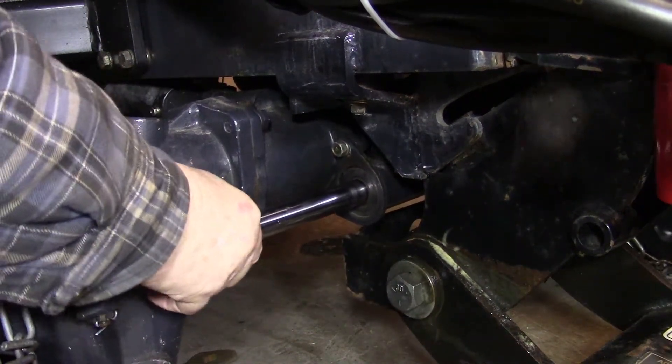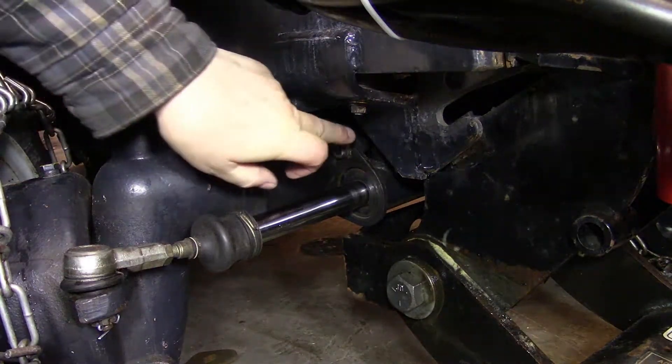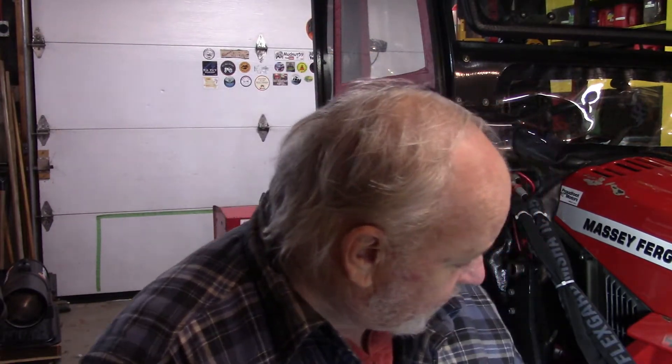You can see that moves around a fair amount in there, so my plan is to change those flanges. What I like to do before I start any kind of a job is check to see if I'm capable of doing it. I can do a lot of things, but some jobs I just won't do because I know I can't. There's nothing worse than getting halfway done and realizing you've made it worse, then having to take it to the repair shop. When I look at this, I see there are two flanges with two bolts in each — as long as the flange fits over the steering knuckle and tie rod, I think it'll be a pretty straightforward job.